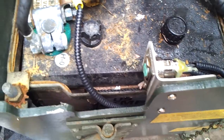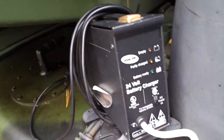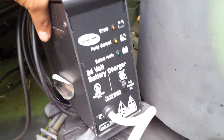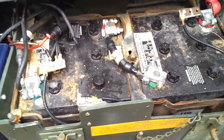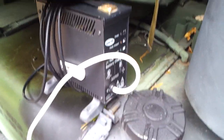Keeping this battery charged at all times is very important, so I've grabbed a 24-volt battery charger - it's actually a handicap wheelchair charger. It provides 8 amps; your standard trickle charger is about 1 amp, which is not very helpful for charging such a large pair of batteries. This can probably be picked up for about $35 off eBay.